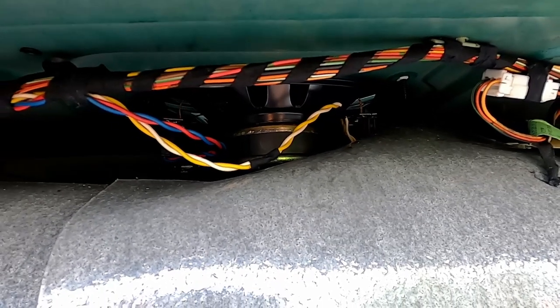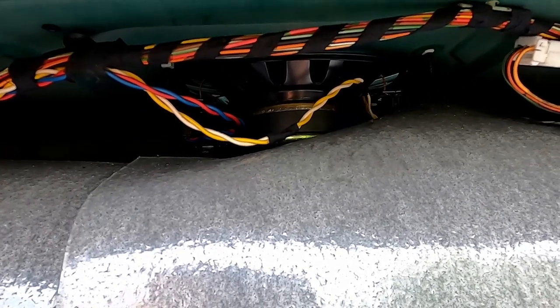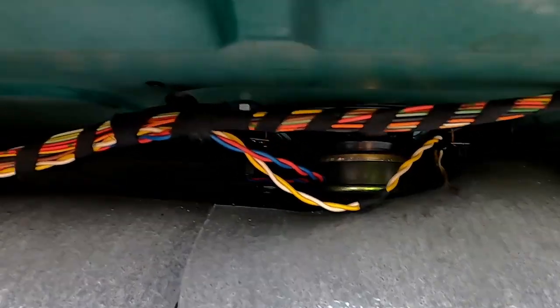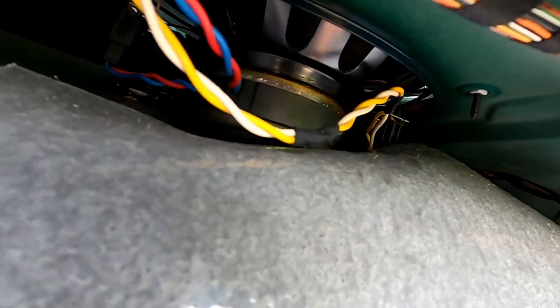There are different sizes and styles depending on the age of the vehicle. This one I believe is the six by nine inch, and I read it's specifically one with a dual voice coil — it actually pulls signal from both the left and right side of the sound system instead of just one channel. You can see the red and blue wires and the white and yellow wires, which would be the inputs for both. It's actually a pretty small speaker wedged in there tight, but it does have this matting between the gas tank and the speaker itself. Now that this is open, I'm going to get some music going and see if I can find where that rattle's coming from.